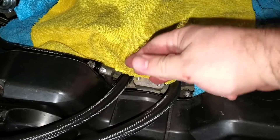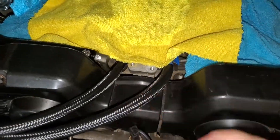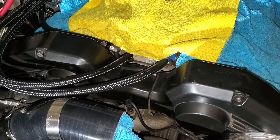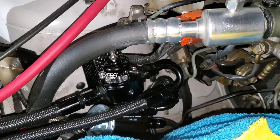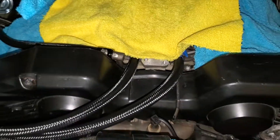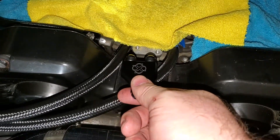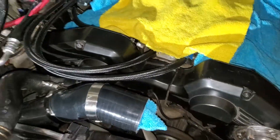The original fuel pressure regulator sits here, with the intake manifold right behind it. My original plan was to get it right here, but since it has two inputs coming off of the fuel rail, it ends up being pretty wide once you put the fittings on it, so that didn't work. Then I thought maybe I'd use a Y adapter and put it right in front, but again it was still too bulky.